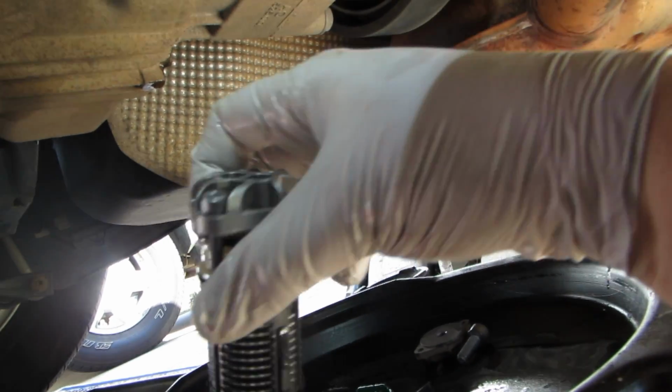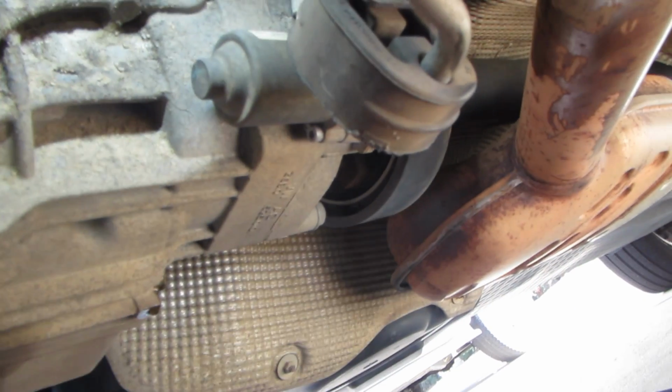Okay, it's time to put the filter assembly in. I can't sneak it in there with the bolts in place. Nope, I can't. All right. I did lube the O-rings with a little bit of the Haldex oil. Let's see if we can press that in. I'm gonna remove this bolt so I don't drop it too. All right. You guys probably couldn't see anything there that I was struggling with.